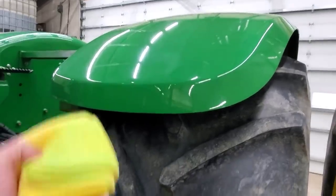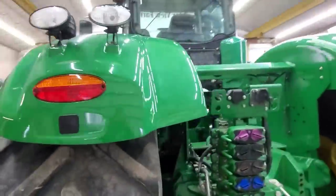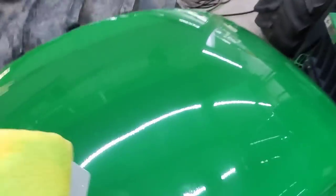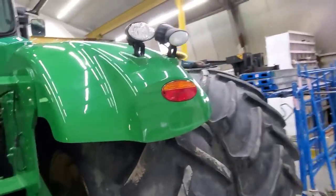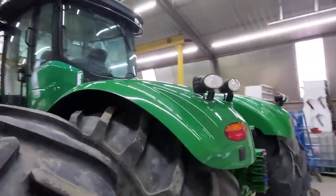The next step is to wipe everything down with rubbing alcohol. I just did the front of this fender and it's turning green — we're getting some contaminants off. It does leave it looking a little dull, but when we put the ceramic coating on it'll shine right back up. I remember from last year thinking it didn't look good enough after the rubbing alcohol, but when I put the ceramic coat on it made it pop. Fenders are all cleaned off and shiny — let's put the ceramic coat on them and make them really pop.